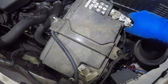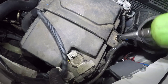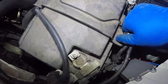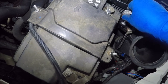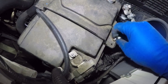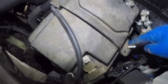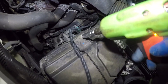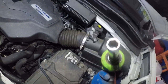I did loosen this up but it doesn't want to come out all the way, so just loosen it up a little bit more. You can even take this off — it broke, but it's supposed to turn off. Just pull it, it's all good. Battery disconnected. Once you take this off, you need to take off this little piece from the bottom, because the battery is held in by this tray.